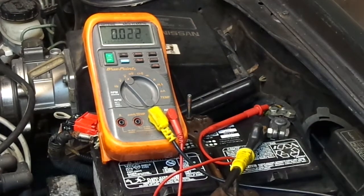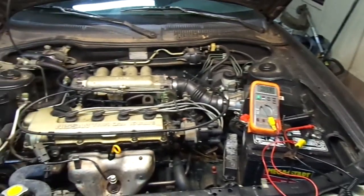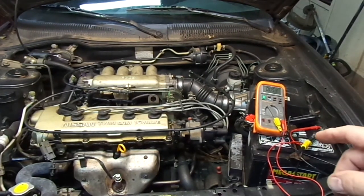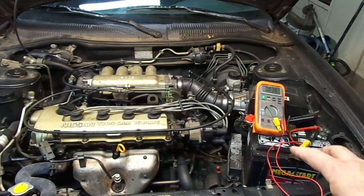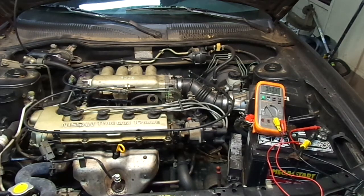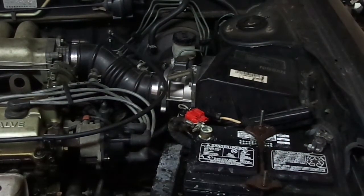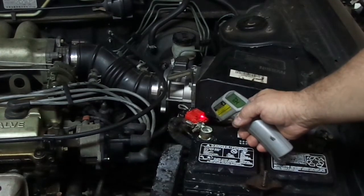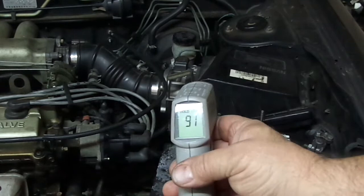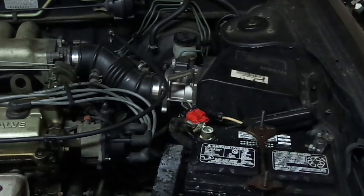Now I can continue the diagnostics on this car's running issue. Until you fix the basic problems, you can't continue with the running diagnostics. The voltage drop test is probably one of the more accurate tests you can do to tell how good your connections are — start at the basics, get your battery cable and everything working first, then finish from there. One last thing: we now have 86–91 degrees at the battery post, which is a considerable improvement, and the wire is cool. Thanks for watching — hit the subscribe button and I'll see you in the next video.